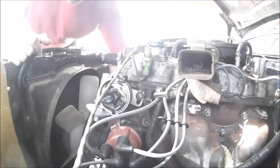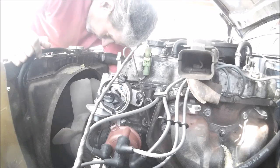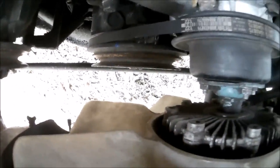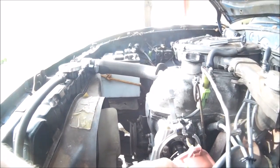Keep it coming around. You could do this by bumping the starter, but I do it by hand because it's a little more precise. I'll get you down in here — see that little blue mark coming around. It went just past zero so we'll bring it right to zero. Okay, that's top dead center for number one. As you can see, the rotor is pointing right in that direction — and there's number one, you can tell because you can see the wire going there. No problem.